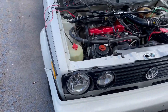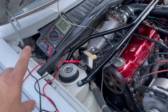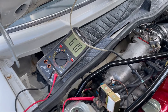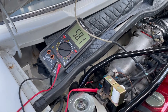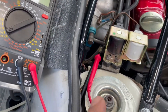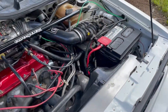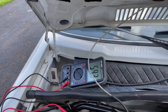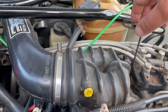The car is fully warmed up. We have the test meter set to dwell, four cylinders. If you look at my readings, they're high — we're supposed to be getting 45 degrees, which is 50% frequency. The leads are connected to the test connector, and you can see my little adjusting wrench is sitting in the hole ready to go. It is running high, so I'm going to make a minor adjustment — just a fraction of a turn.